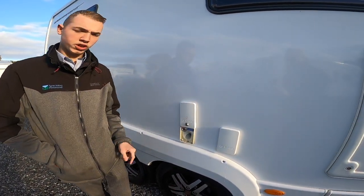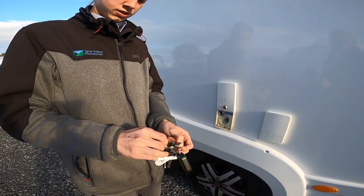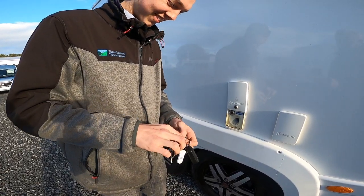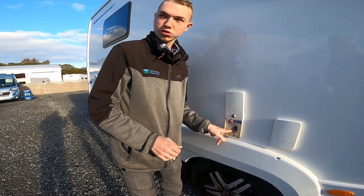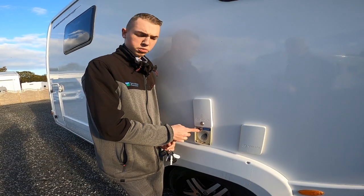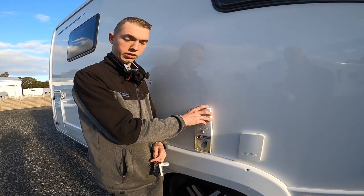And then on the keys there'll be a little key here, and that is your water key, so you can lock this flap, put a hose pipe in there until it overflows, or you can fill it with a submersible pump into an Aquaroll where you turn the tank fill on and the settings on the main control panel.